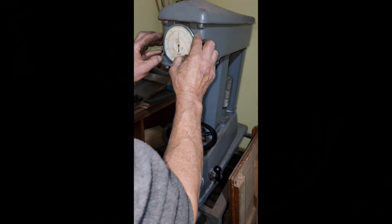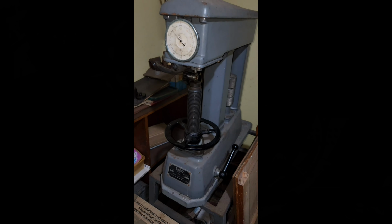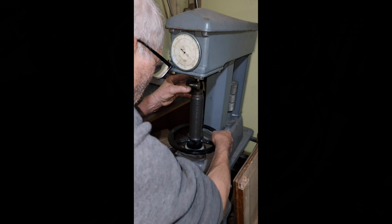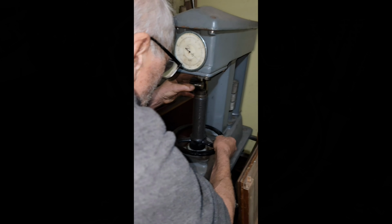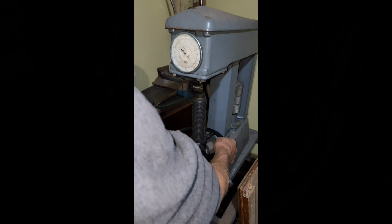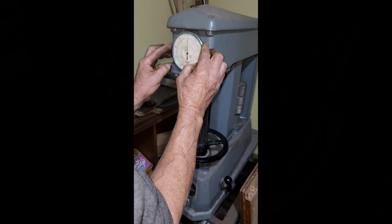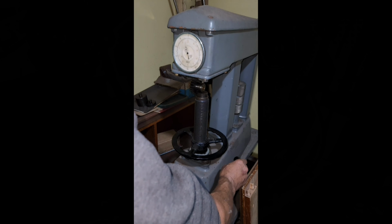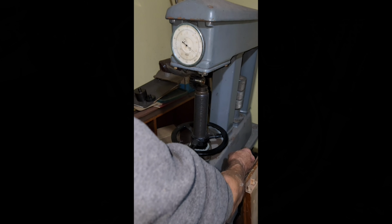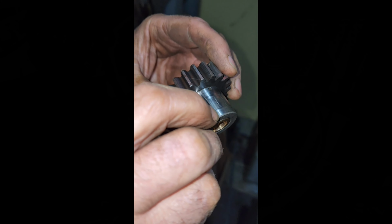Because remember, this is case hardening. And it's only shallow, so I'd just concentrate on that. Well, there we are. We're back to 47. So we've had 2 at 47. We'll do it a third time if we get 3 at that. I wriggled it a little bit just to make it settle in. There we are, 47. You can take that. And there's your little impregnated mark.